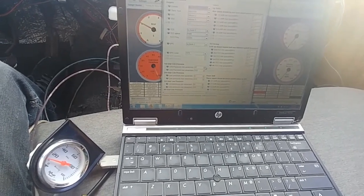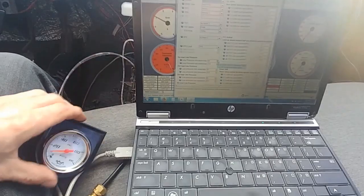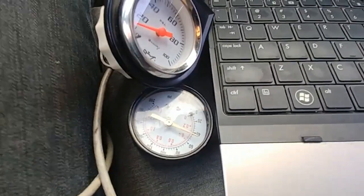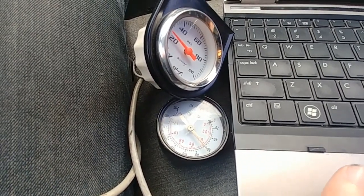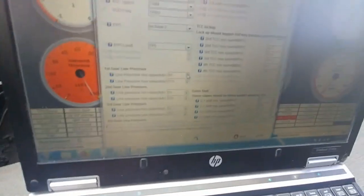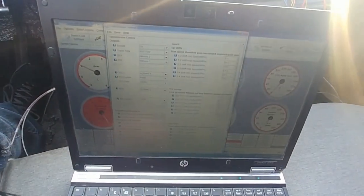Converted it to a 4R70W - it's working pretty well. Let me show you guys real quick the line pressure. Coming down here, if we increase line pressure minimum we should be able to see a response on one of our two gauges. So 65 seems to work well - we'll go with that.